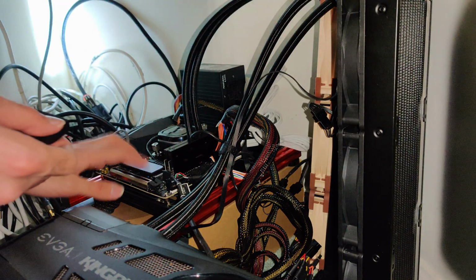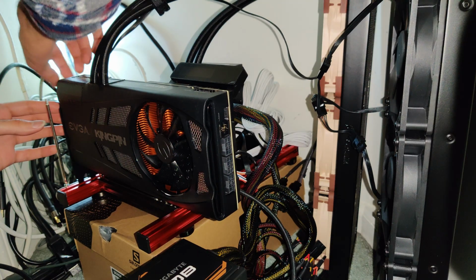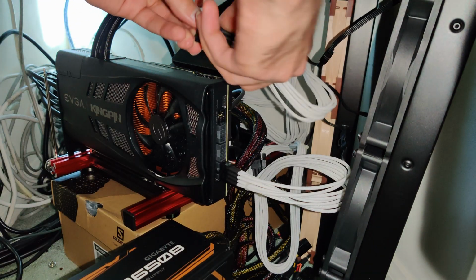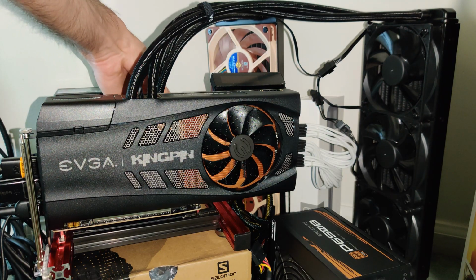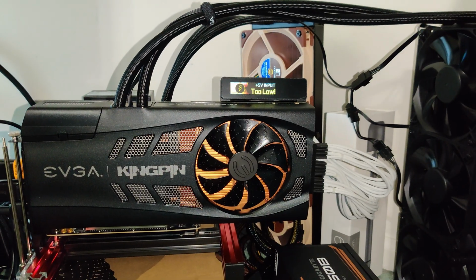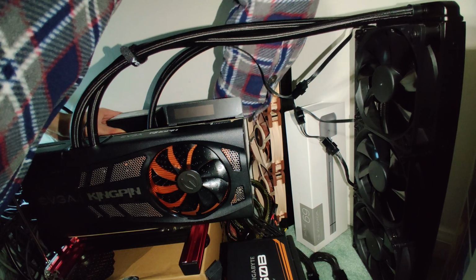Now I know. So what you see me doing is trying to hook up the power supply, Corsair One, to the GPU and try to power it without doing that. Didn't work. And then I tried to short it to start it. It didn't work with the Corsair One at all. Those holes aren't there in the 24-pin connector. And then I was able to do it perfectly fine on the Gigabyte. So you'll see that in a follow-up video.